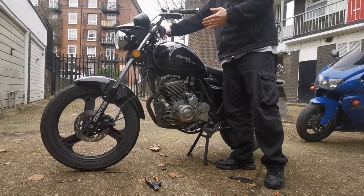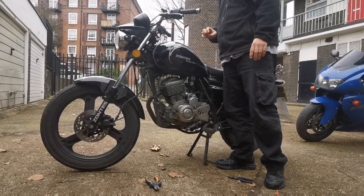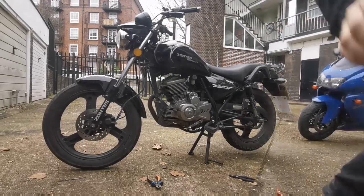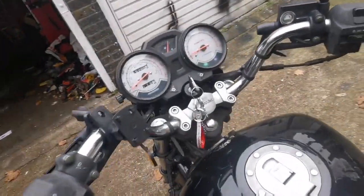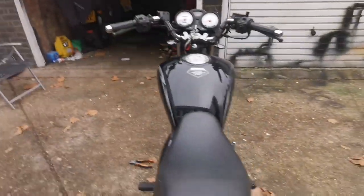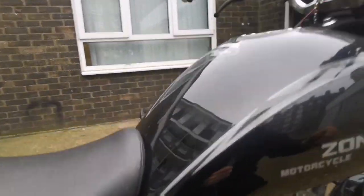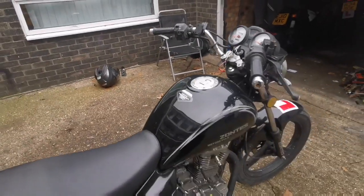That is exactly what was happening yesterday. You touch the throttle, it cuts out. But it was working with, let me up the idle a bit. It was working just a minute ago with full choke. That leads me to believe that the carb is blocked somehow again, which shouldn't happen. I mean, it's practically impossible. It had a filter on it.